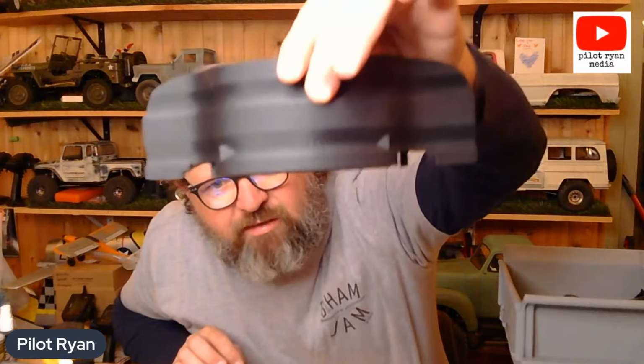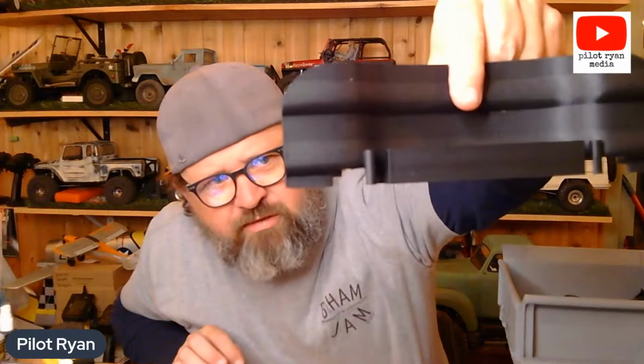The pins went in the stock location holes, and the rectangle gives me something to add additional strength by bolting to the chassis. And then when I put the chassis on, it comes on, keys in, because this is mounted to the chassis by itself. Believe it or not, this is mounted to the chassis by itself. The whole body comes in, puzzle fits into this, screws down in the back, same holes as the Ford had, and it's not going anywhere. I can lift it up by the bumper.